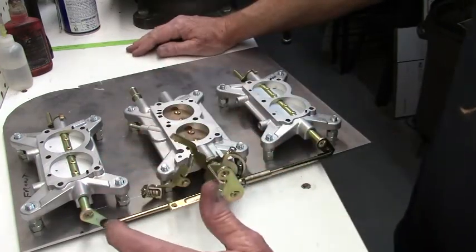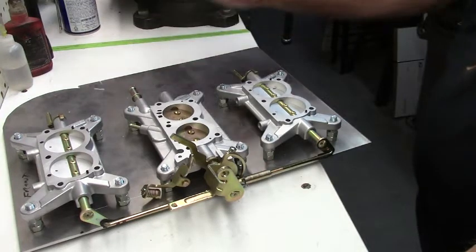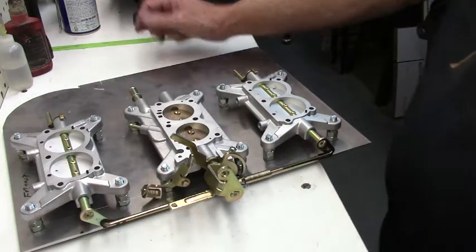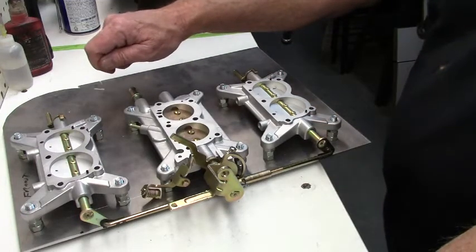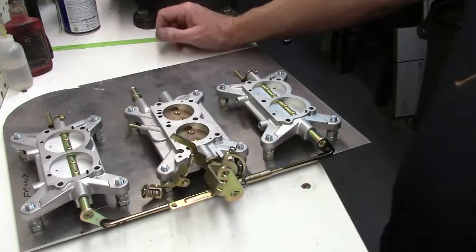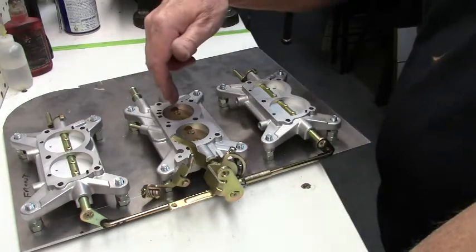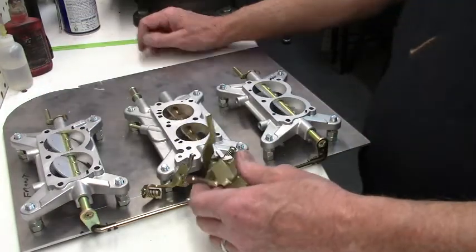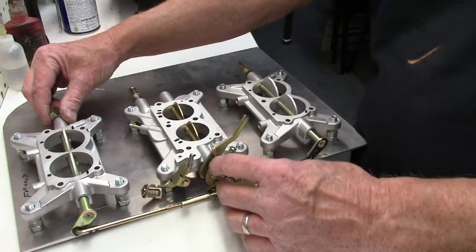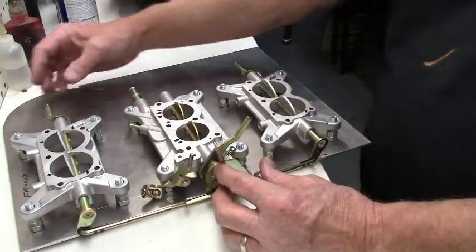This is our A and B setup. If you just follow what I said you do on it, just be cautious about those outboard carburetors. When they're not captured with this link rod, make sure you disconnect the vacuum source from the center carburetor, the ported vacuum source, before you start monkeying around with them. Because when you start revving this up and there's no link rod holding these, and you get enough air to start working that venturi port that controls those, we're going wide open throttle, the vacuum pods come in, pull it open, and then the throttle arm and linkage are going to close those outboards, just like that, you know, it's closing them.